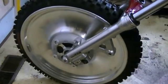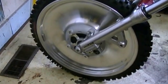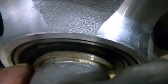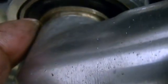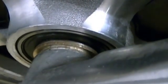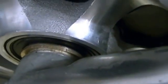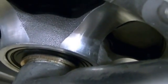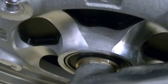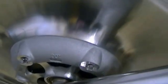Different front wheel. That's a solid wheel off of a V-rod. All I did to make it fit, so you can see, there's a brass bushing in here with a lip on it. I made this to fit inside the 1-inch bearings. These V-rods, well, most Harleys now run 1-inch shaft for axles. So I built these bushings so that I can use the original axle bolt, and I can take my other Honda Sabre wheel, just pull the axle out and stick the other one on, and then it has front brakes and whatnot too.